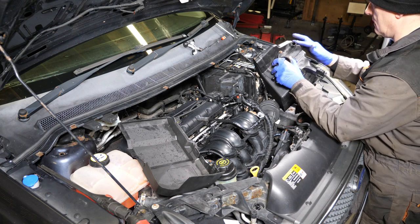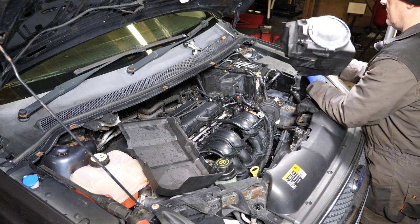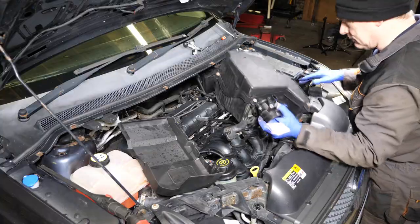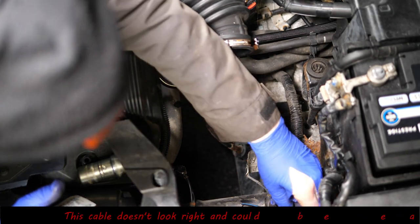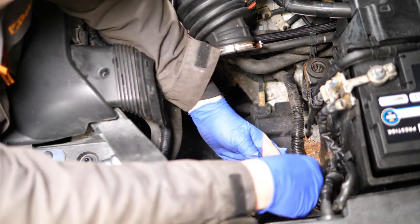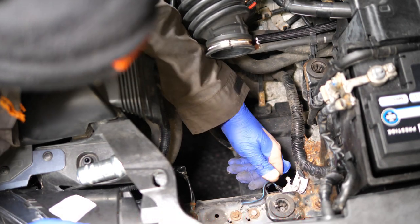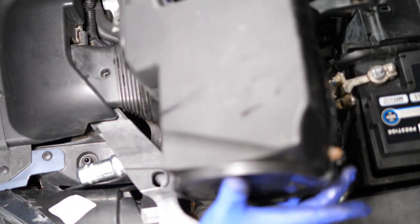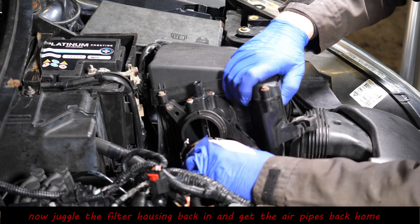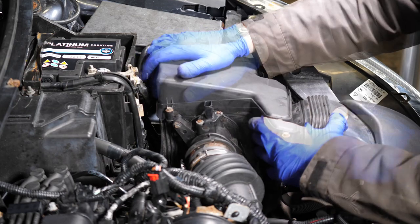Before popping it back in, I'm just checking the orientation — there are a couple of cables down there near one of the grommets. I can see a cable that I'm not sure is in the right position — I think it should be on the other side of the grommet, so I'll bring it back over. There's a real risk of getting that cable pinched by the air filter when putting it back in. I notice those nuts look quite rusty — I probably should have removed them all and cleaned them to ensure better earth connections.